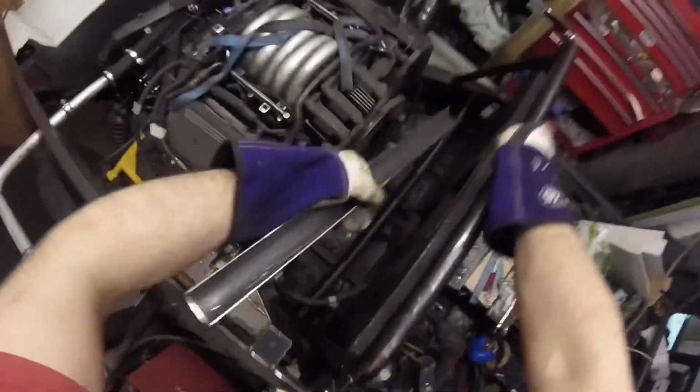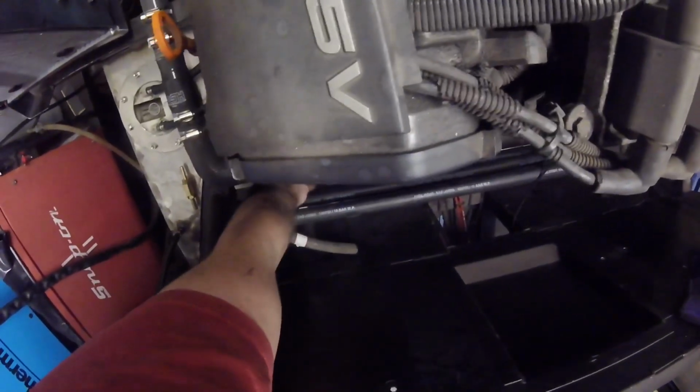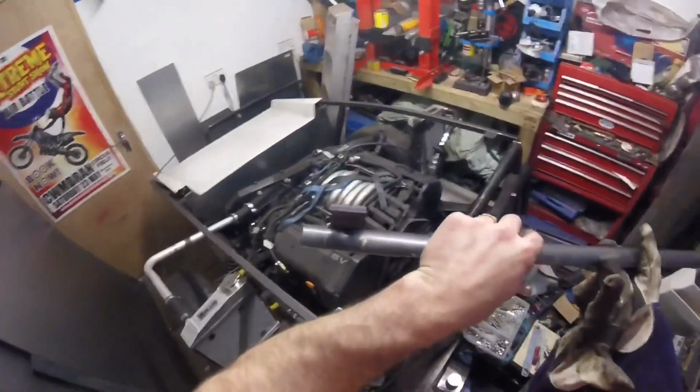We've just tacked these legs on the bottom of this bracket, and we're just gonna test fit it to make sure it fits okay before we weld it all up. And that fits on that hole, and that could do with coming off and going down a bit more. That one's okay, it's not too bad, and it's not rubbing on the cable underneath, which is great. We got about 15 mil underneath there. Take this one back off and move it in, looks like 4 mil. Oh well, take this one back off and move him over a bit more.